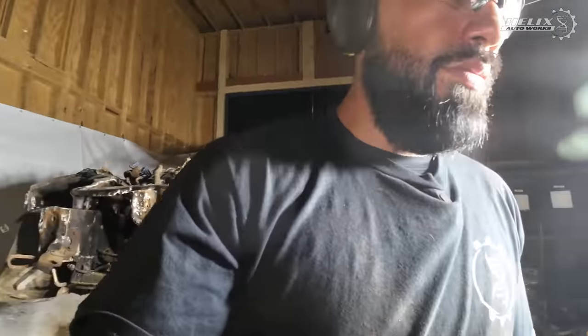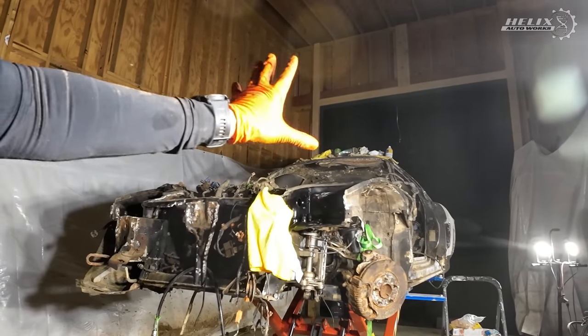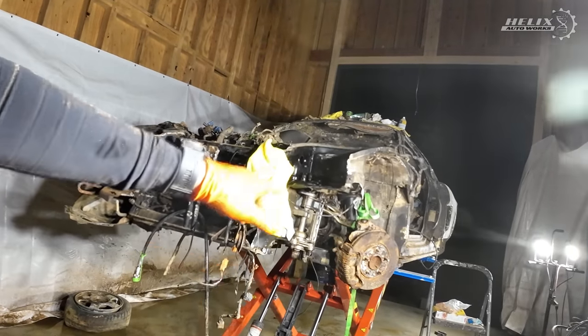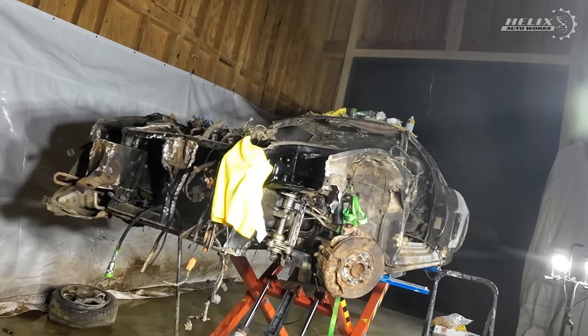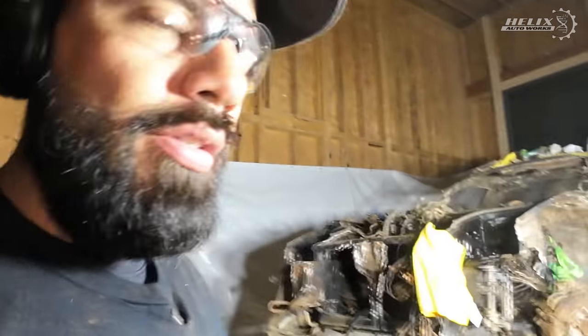and remove the whole assembly, drop the car. So as you can see, all the upper and lower control arms, everything's just gonna drop. So I'm gonna lower the car. I put a little strap, so when I'm finished cutting the alignment bolt, then everything's gonna drop in one piece. So trying to prevent that. I also don't wanna damage the floor. So yeah, that's what we're gonna do. So we're going to hyperlapse. See you.